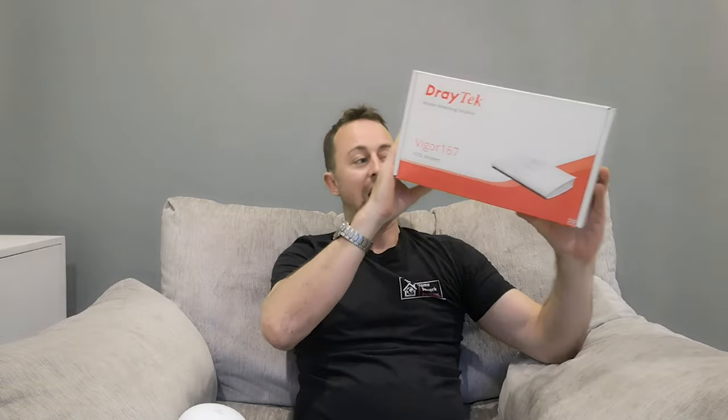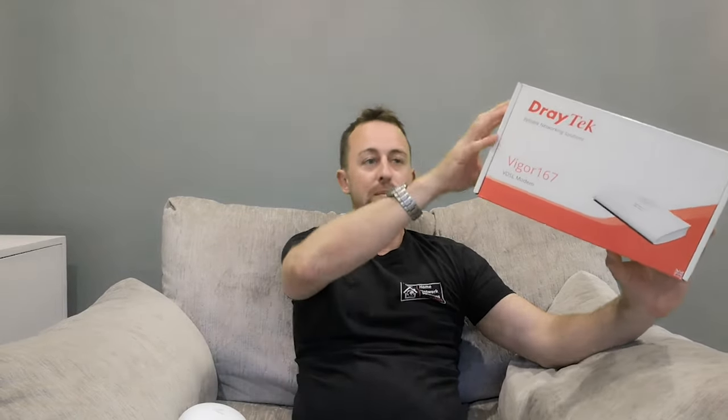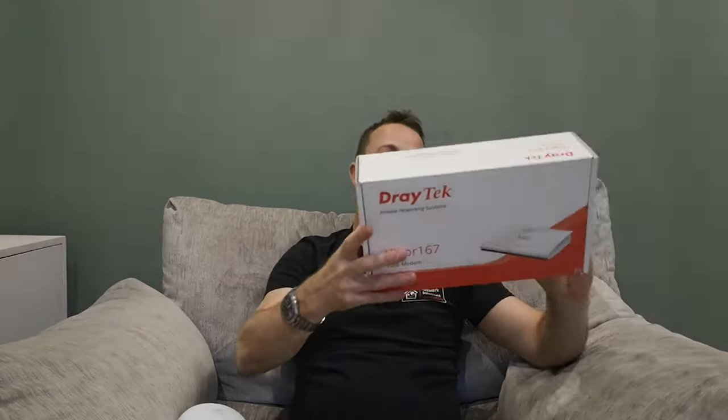It's perfect for a small home setup. The setup of this router is very simple. The first consideration is that this is just a router — it doesn't have a modem. So if your provider doesn't give you a modem as part of your internet package, or you don't have a router that can be put into modem mode, then you need to buy a modem. For example, if you've got a VDSL connection you might want to use something like the Draytek Vigor 167. If you're using Starlink you'll need to put it into bridge mode — we have a video on how to do that, just click on the cards.